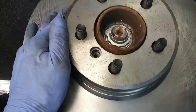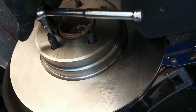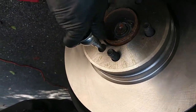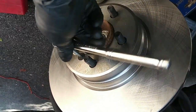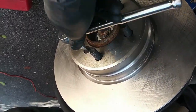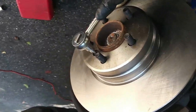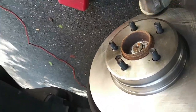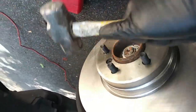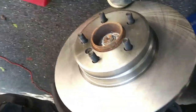Make sure it only goes that one way — otherwise you won't be able to put the screw in. Now we're going to tighten down that screw and get it nice and tight to make sure it holds the rotor secure in place. There is a suggestion to do this with a torque wrench, but you can pretty much do it hand tight because the wheel is going to go on over top of this. Once you tighten down the wheel, the rotor isn't going anywhere — just get it nice and snug and that's good enough.